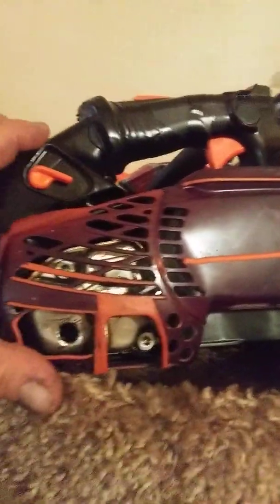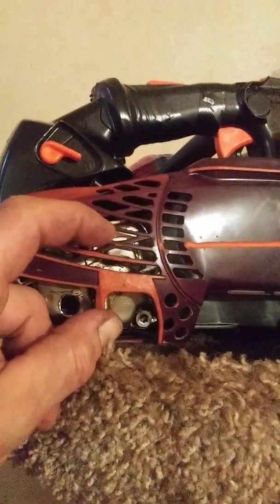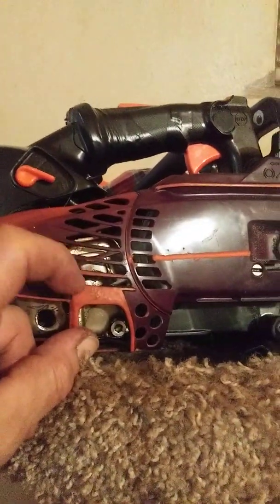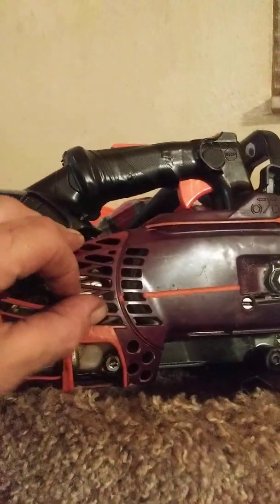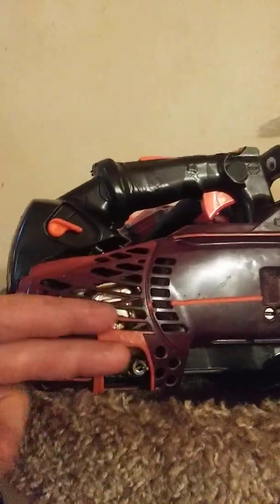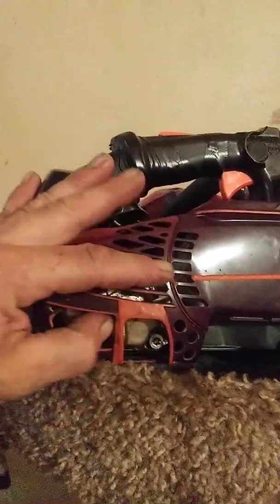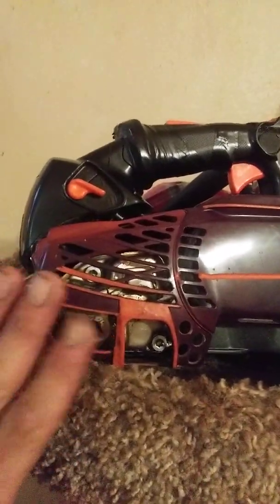Now for the muffler. The most common muffler mod is simply opening up the muffler's exit portage, and on the 2511 that's actually quite significant — we're talking about 15% gains in horsepower. However, there are still two more choke points at the muffler you could address to get even more flow.